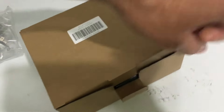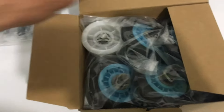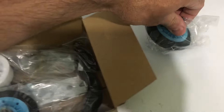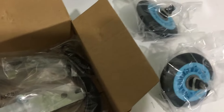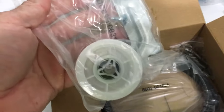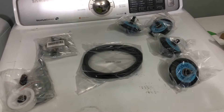Because of our failed bearing, you can get bearings but you can also get the belt as well. This dryer is eight years old, so it's probably due. Another $30 box contains our four new bearings for the drum — there's two in the back and two in the front that the drum rides on. While we're here, we might as well replace the belt since we have to take the drum out anyway. We also have a brand new tensioner for the belt, which we'll replace along with the spring that keeps tension on the belt, and of course the belt itself.